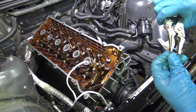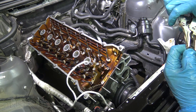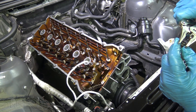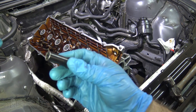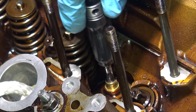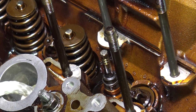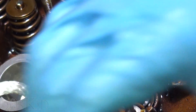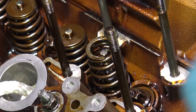The lesson here is that you can get it done with pliers, but it's probably just easier to get the proper valve stem seal remover and installer. To reinstall, I'm going to use a 10 millimeter deep well socket — it fits just perfectly — to push the seal down. That was extremely easy. We'll go ahead and put the spring back on and get the spring retainer on there, then put the little valve keepers back in.